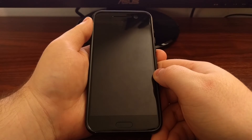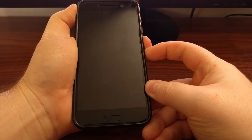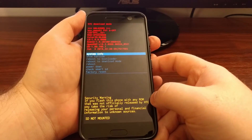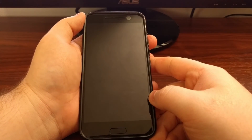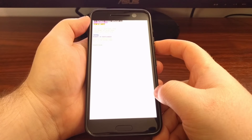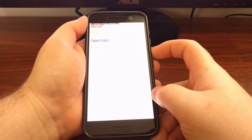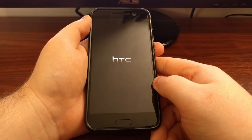The device is now powered down. From here we need to boot into bootloader mode. We are now in download mode — highlight Bootloader Mode and tap the power button to select it. It's going to boot us into bootloader mode, also known as fastboot mode. As you can see at the top, we are now unlocked and we are now S-Off. Before, that said S-On. We're going to enter recovery mode now, which will be the TWRP custom recovery we have installed.